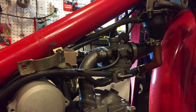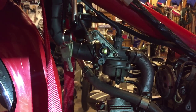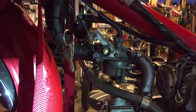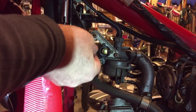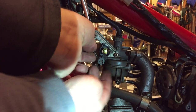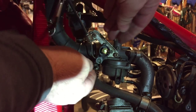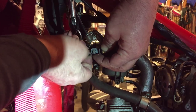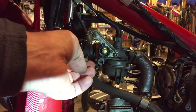I'll take the camera around the other side of the bike to see the choke cable — sorry, choke cable — that goes into the carburetor, and then the throttle cable as well. Here's the other side of the carburetor, and here you'll see the choke mechanism. As you pull on the choke cable it's a little stiff — it didn't come back, so I'll lubricate that cable too. The way to remove this cable is to hold on to the cable itself, push the mechanism, then twist the cable around until it pops out — a bit like a lever on a handlebar. That little trunnion just pops out there, and that's the cable removed.